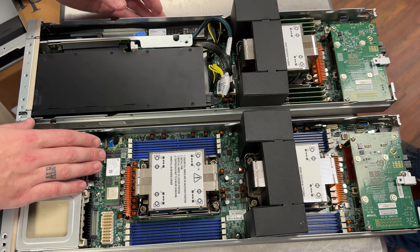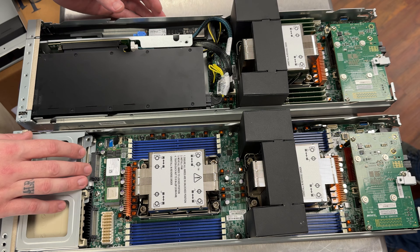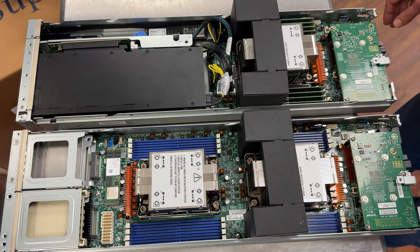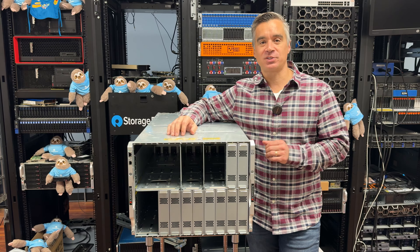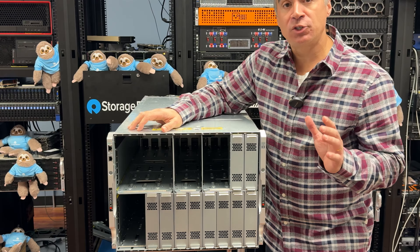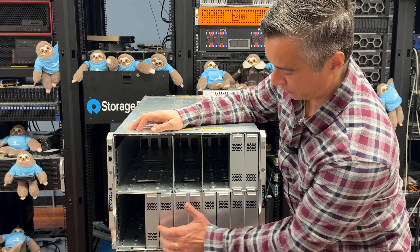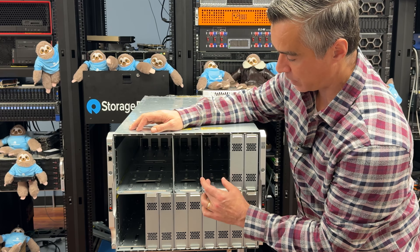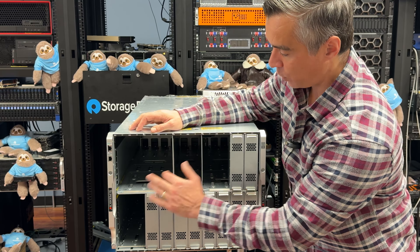Starting at the back, they've got the same connectors, so they just chunk into the chassis the same way. They look the same until you get past the first CPU heatsink and DRAM cluster. The boards are almost visually identical all the way until you get past the first heatsink — over here they just replicated a whole other CPU and DRAM bank, while over here it looks like they chunked it in half and put on the power and PCIe delivery lines. On the front we've got our M.2 boot SSD, two NVMe bays on the bottom, and a riser which allows for flexibility for two additional slots. Now let's throw the lids back on, get the intern to get the chassis out, and get back to business.